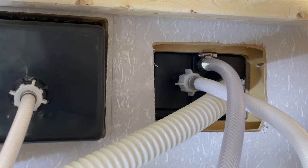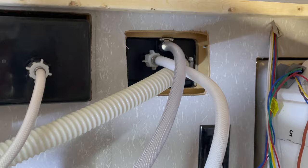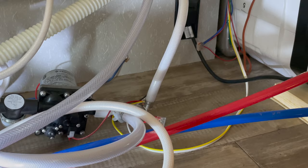I tested that out and was able to fill my tank to its full 26-gallon capacity. As you start getting towards the top, you actually hear the water start coming up the main inlet tube right here. You start to actually hear it as the tank gets full. If you were to overflow, you would have water come out of either that tube - which is the water coming in - or it would come out of the vent tube.